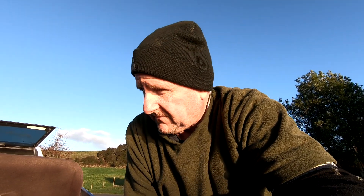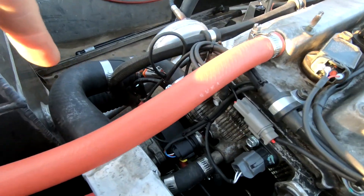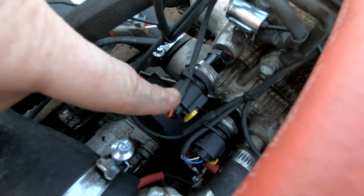I've made a couple of changes with regard to the sensors going in. This one's got a combined pressure and temperature sensor — they're a Bosch product. There's a bit of debate: not everyone agrees on how they should be mounted or where they should be fitted. Some say they should be at a 45-degree angle, some say they shouldn't be mounted to the engine and should be remotely fitted to reduce the chances of premature failure. We've fitted them to the back of the cylinder head in both cases, directly to the engine — there are little screwing adapters. Time will tell if it's successful.